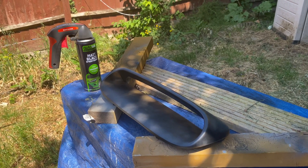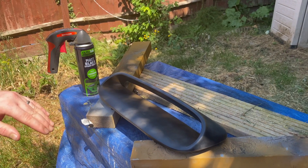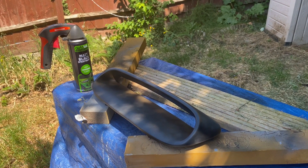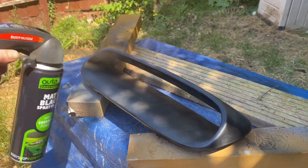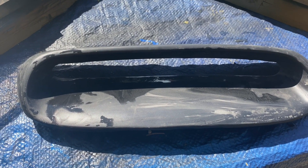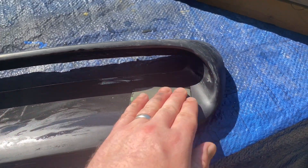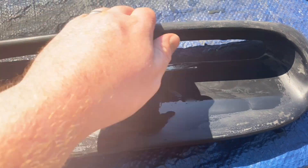The tack coat is now dry. We're going to do thin layers - not as thin as the tack coat, but make sure everything is even. With primers you can sand it down and do it again, but with paint it takes a lot more effort to get it smooth, so just make sure you're doing it in a nice smooth even flow. I've now done seven coats of paint and I'm going to wet sand it very gently just to take off any little bobbles - or in my case any dog hair that's got caught in it - to give it a nice smooth finish. Then I'll put two more coats on and it's ready for the lacquer.